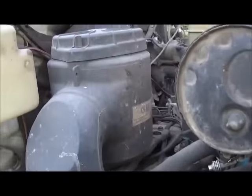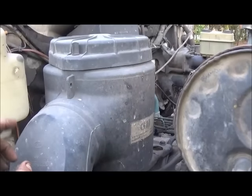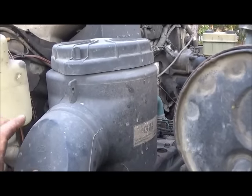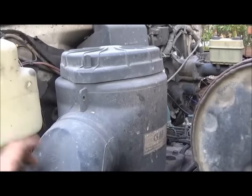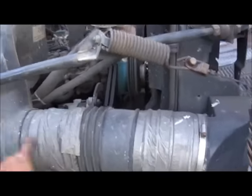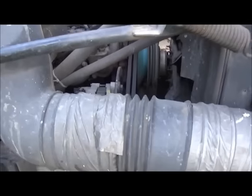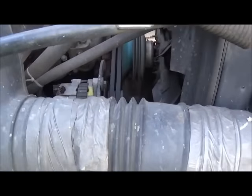On this side, I made the bracket to mount the air cleaner. I wanted the original GM air cleaner — that way when you buy it, you can buy the right part for the right year truck. You can see I've got some duct tape around this air intake, but it's held fine. I've got it running to the original spot just like it was — I think this was a little different length, and that's why I've done that. But it's worked good.